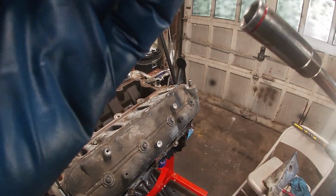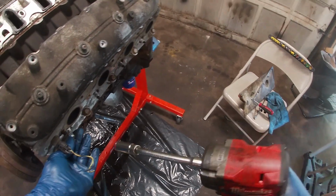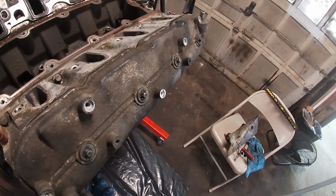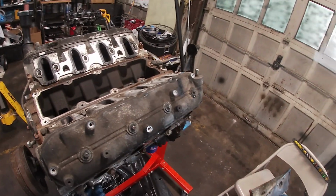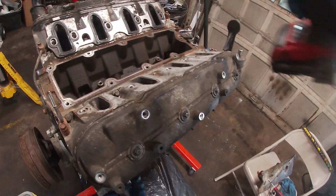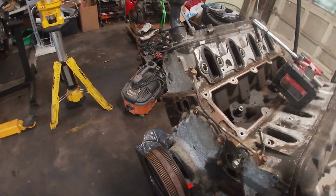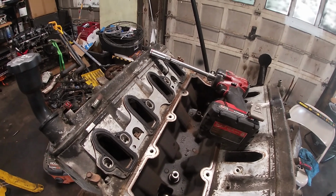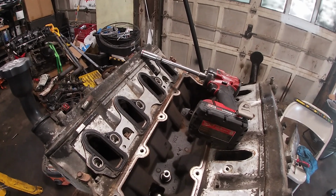These plugs are great plugs. Double iridium Bosches. Wow. They're brand new too. I'm gonna keep these. Not garbage. Nothing here is garbage. Looks to me like this was a very well-maintained engine that has had something go wrong with it, but I think that it's user error. I don't think that the engine itself has an issue. I think that this intake gasket was put on incorrectly, the same way that I would do it, which clearly is why all of my stuff has manifold leaks or vacuum leaks. Yeah, has to be what it is.